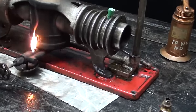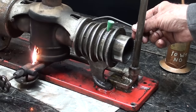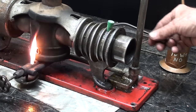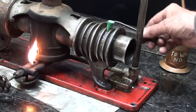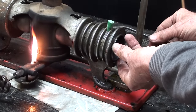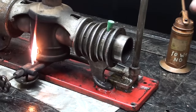Look at the green plug — there should be no leaks right there. Now I'm going to move the displacer back and forth by hand and watch the piston. See it's being pushed and pulled — I'd say about a half inch of motion, which I don't think is enough for it to run. When it comes out too far, you see I've lost the seal. That's five-eighths of an inch. I almost feel like putting it back together and trying it. I think I will.